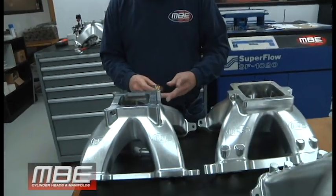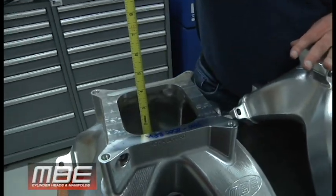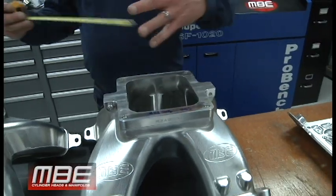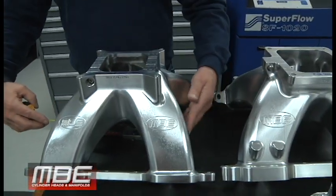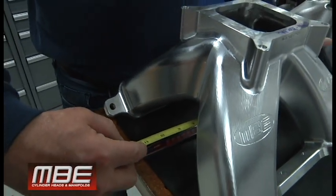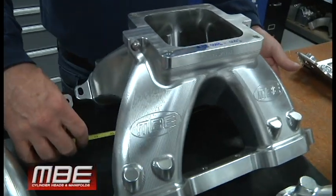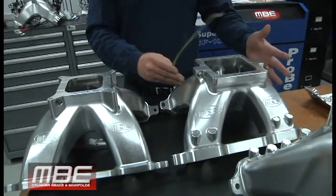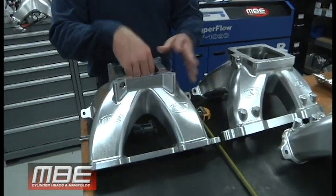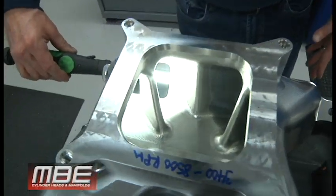Let's look at some of the measurements and the differences. Here in depth we're at four inches; over here we're at four and a half to almost five inches. Now if we go width-wise on the plenum — let's do the outside because it's easier to see — they're both the same thickness. This one is about seven and a half inches, and then the drag race application is nine inches — over an inch wider. It's wider this way also. And the runner in this manifold is an inch longer than the runner in the drag race one — you can kind of see the differences in runner length.